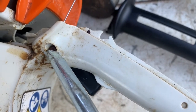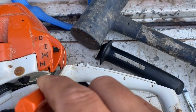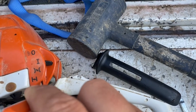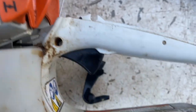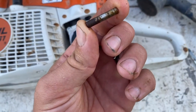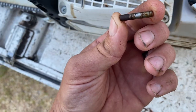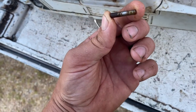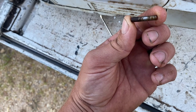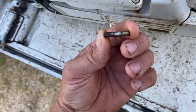Now I'll take the pin — that's just a pin. You can take a little hammer or mallet. Be very, very careful, but you can take a little screwdriver or knockout punch or something in the field. All I have is this little screwdriver — push and tap it with that mallet and then push it out. I knocked out that pin and you can see all the way through. You can see the little rust on that pin. A piece of sandpaper will help clean that up, or a wire brush on a grinding wheel in a shop. Out here in the field, I've got a drill and a wire brush — let me see how I can clean that up and I'll get back to you.